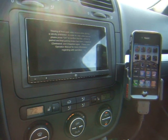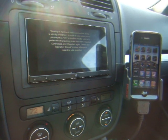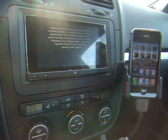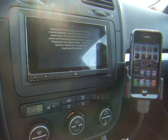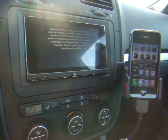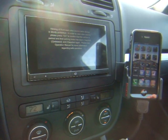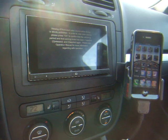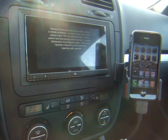I'm not aware of a current good bypass for that, so either you're going to need to actually connect it to the switch for your parking brake, wire up a switch, or examine how your car-specific interface works. In my case it's a PAC interface and it uses speed to determine whether the parking brake is on or off in terms of the signal sent to the head unit. So in my case, if I wanted to use video right now even though I've just turned the car on and the parking brake is on, I need to accelerate over three or four miles per hour and then come back to a stop, at which point I'd be able to use video.